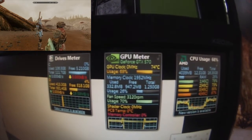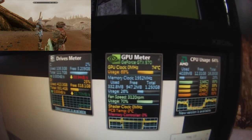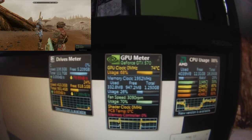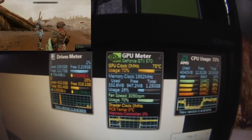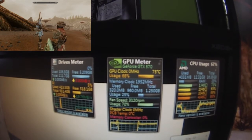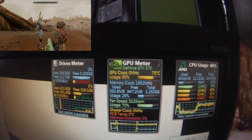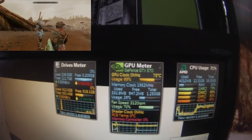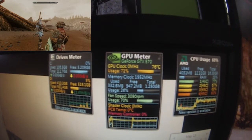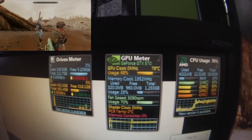As you can see, the chart in the middle is for my GPU. It's a GTX 570. All the specs will be in the description if you want to know about my computer. At the top, you see yellow lettering. Those numbers are the temperature of the graphics card. You usually don't want to sit anywhere above 75 to 80 degrees Celsius. Now, I'm playing Skyrim with an ENB mod, which is pretty taxing on your GPU.